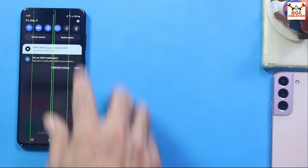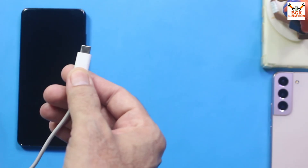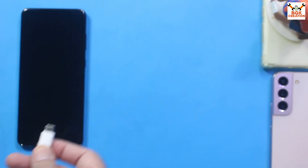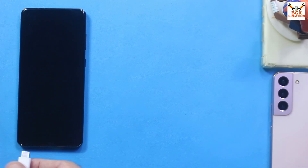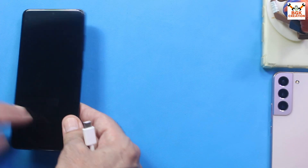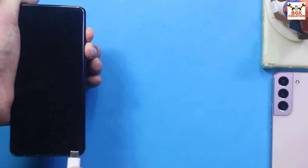Go back, then go to Lock Screen and turn off the lock screen by selecting Swipe. Once all these steps are done, power off the phone. Use a good quality data cable. The phone must be powered off. Make sure the other end of the cable is connected to the computer before proceeding.